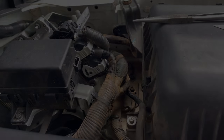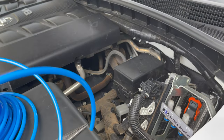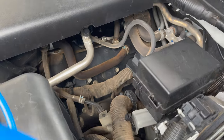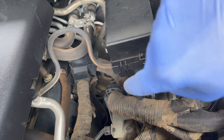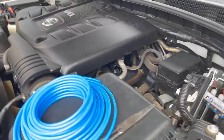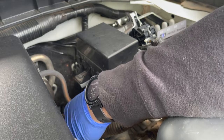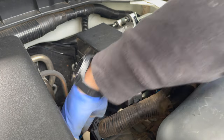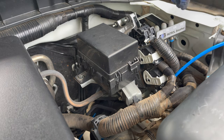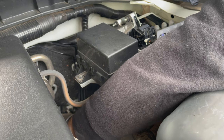For the rear diff, I think it'll be easier to start my feed from here and channel it down the way I want to go. I'm actually going to try and follow this existing one that I've just done here, going down along the chassis rail all the way to the back. So we'll try and start feeding that down there as we go. You want to be careful so that it can't touch anything or rub through on anything — if you want it to last it'll be 100% waterproof. We'll go cable ties all the way down and along once we've found our nice route.